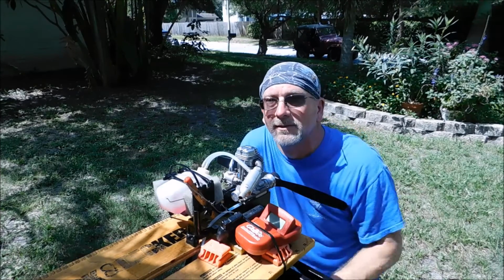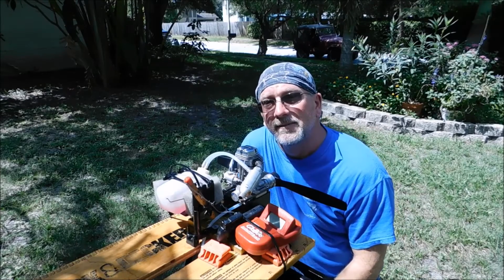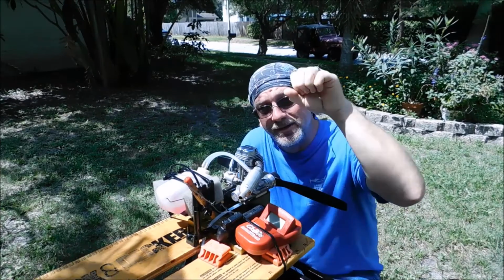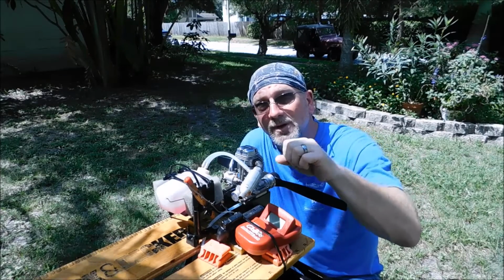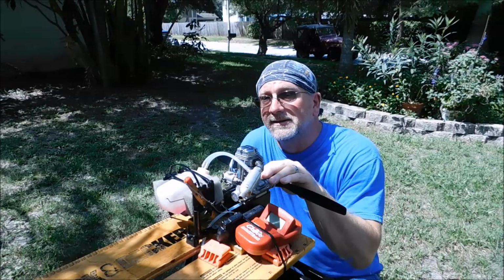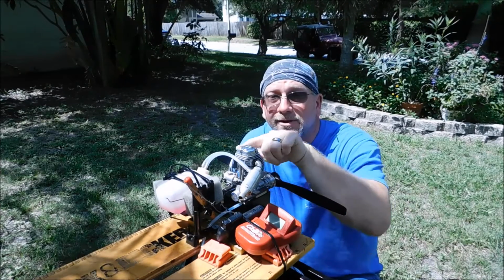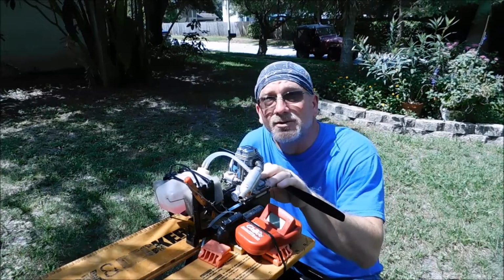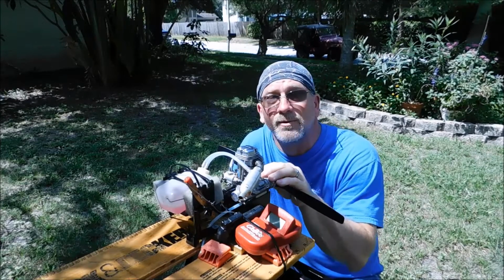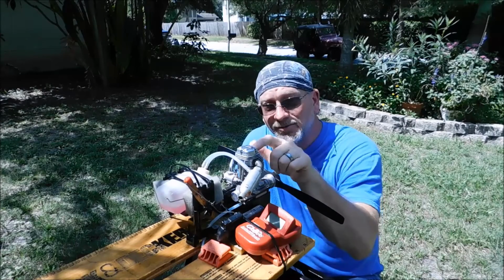Make sure that the insides of the screw heads are clean, they don't have any debris in there, so you can get full engagement. Make sure you have the proper size hex key, and as a safety precaution, you might even want to just hit the area with oil and then some heat too, just to make sure that you've got the best opportunity to get that fastener out without stripping the head.